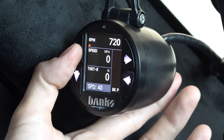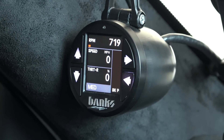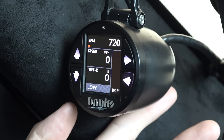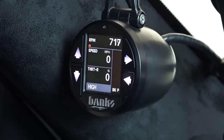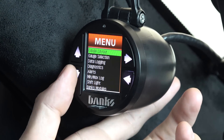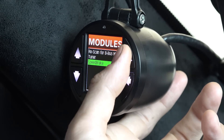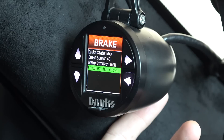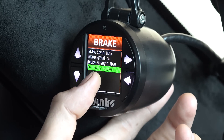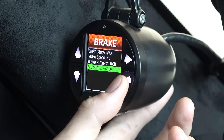If you hold the up button, this turns the speed brake off completely so it's deactivated. Hold again and you're in manual mode. In manual mode, as soon as you're off the brake, the speed brake adjusts its force based on what you have it set to. Press down to go to low or press up to go all the way to high. There's one last setting for the speed brake, which is the foot brake. To access this, press menu, go down to Banks Modules, press select, go down to speed brake, press select, and at the very bottom you'll see the foot brake option. Right now it's set to not active — go into that and activate it. You can also change any of these settings in this menu, but it's quicker to access from the speed brake layout.